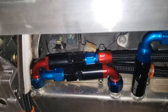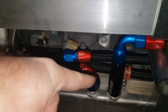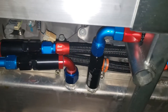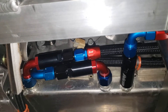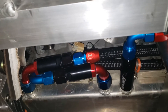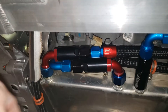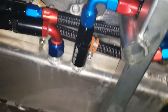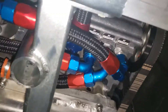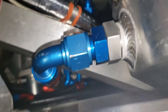You can barely see up in there. I've got three scavenge lines — one back, one middle, and one kind of towards the front. The pan does have a baffle screen and a little bit of a windage scraper, and those black fittings right there are just screen filters. That runs up to the oil pump — you can see just the bottom of it; everything else is tucked up in there really well.